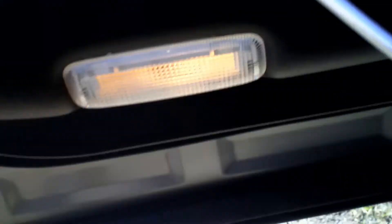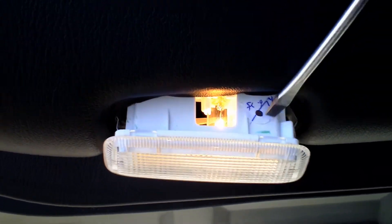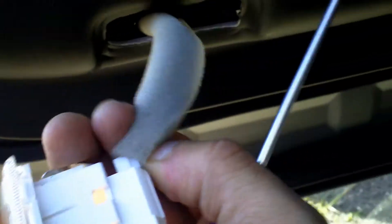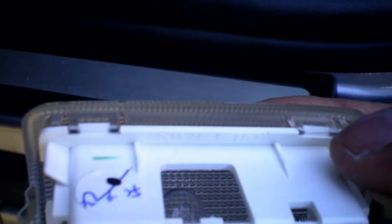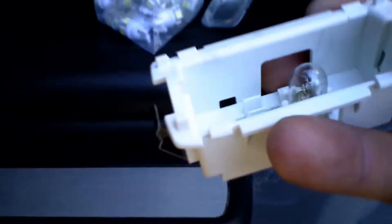On all the doors it's got a light like this. Put the screwdriver there, pry it out — very simple, side to side. Take it out, disconnect it. Once you disconnect it, you'll see little clips. Get a flat tip screwdriver in there and lift that out. Once you have the little cover off, get your flat tip and pry that little guy out.